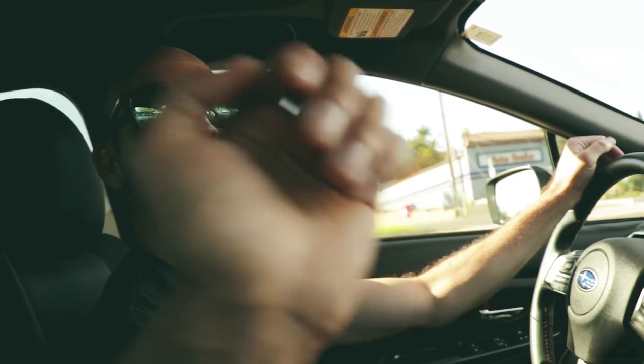Is there anything this might do to wear out the clutch more prematurely or put pressure on it? No — the plates are still disconnected. All you did was bring them closer together but they're still disconnected, so nothing really changed. You just shortened the travel from flywheel to the clutch plate. Super happy with the clutch stopper — it feels so much better.